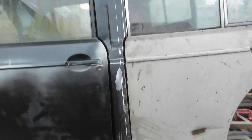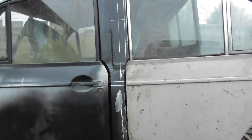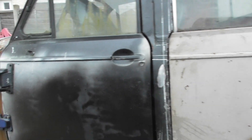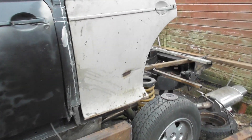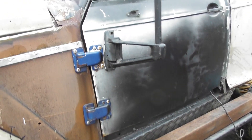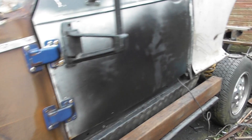It kind of leaves me with one option only. I'm going to have to cut from about there all the way down, get a piece of angle, cut it like I did with the roof piece for the back, and weld it up on the inside so it's just below the edge so it doesn't hit. I don't have any choice - I can't see any other way around it other than putting external hinges on. I much prefer external hinges but he doesn't have any more vans down there with those, and to be honest they weren't that great. They make the door stick proud of the metalwork as well, whereas this one is actually more flush.